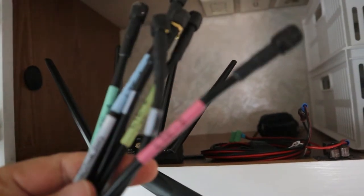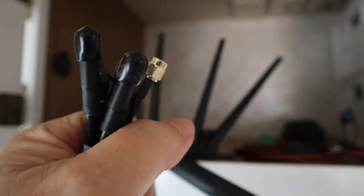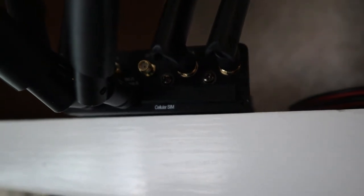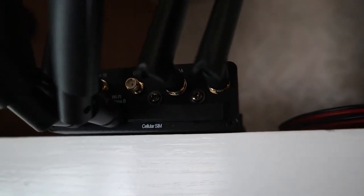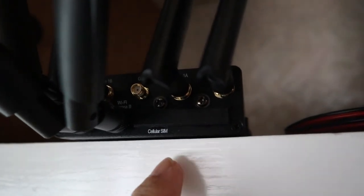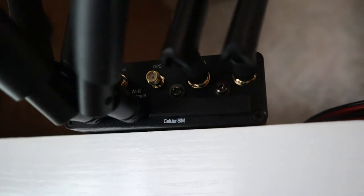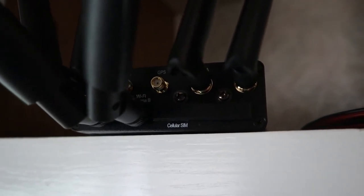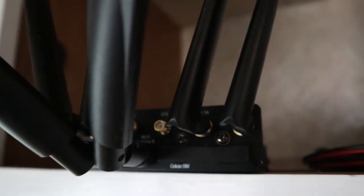Here's the other end of the cables coming from the exterior antenna — they're all labeled, so it's pretty easy to figure out where they go. There are little rubber caps on the ends, but I'm going to tape them up so they're all taped together and I can push them through the holes. Also, you get a SIM card from your mobile carrier — whether you use AT&T, Sprint, Verizon, whatever — and you'll probably need a hotspot or WiFi plan. There's a door here, and behind it you put in the SIM card. It holds two SIM cards at once, so we have Verizon and could also get AT&T as a backup, since some areas have better coverage with different companies.